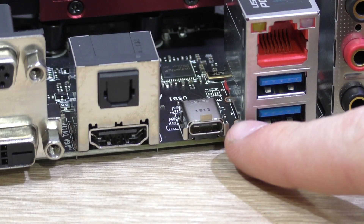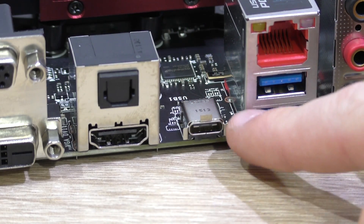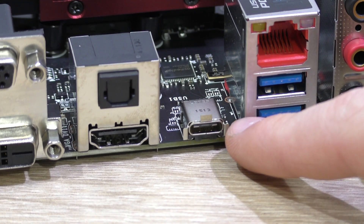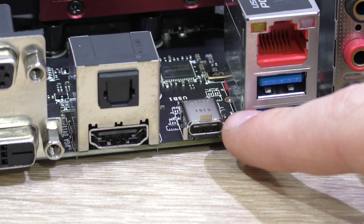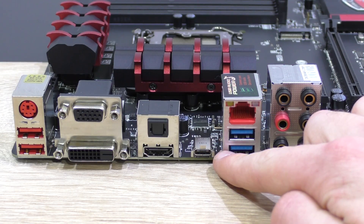I love that port, and let's be honest, everyone has to love it. It offers speeds up to 10Gbps, which is twice as much as USB 3.0, which is only able to provide 5Gbps. USB 3.1 will therefore be able to boost transfer rates of external storage devices, and thanks to the new Type-C connector you can blindly connect any device to that port — no matter how you plug the cable in you can't do it incorrectly — and besides, it's much more robust than previous USB ports. That's what we've been waiting for, and I'm glad MSI implemented this port so quickly.